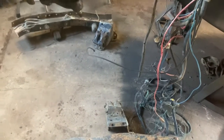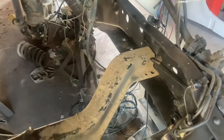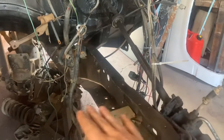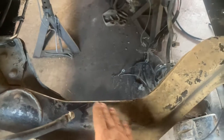There are no holes for any of this, so I'm going to have to measure a whole bunch of stuff — figure out how far forward it's got to go, figure out where the motor mounts have to go, and then go from there. I think I'll go online and see what other people have done, see if this is a common problem with an easy solution. I'd rather modify the motor mounts than the frame. I just have to figure out if it's the top or the bottom of the motor mount to modify. If it's the bottom, it will sit lower, which is fine, but then it might hit the cross member oil pan. Although I could always trim the cross member and plate it — so that's not too big of an issue.